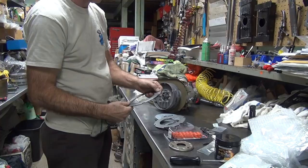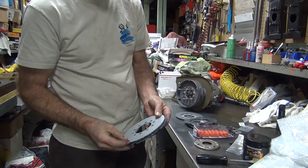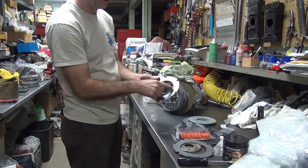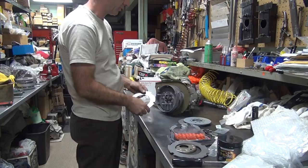It looks like it's in the plate material, too. It's in the wear band. That way it eats up the outer plate a little bit. That's good. It's only got two tabs on it instead of three like a big twin. So out goes out. You know why they do that? Because if you turn it around the other way, the load hits this button and breaks it right off. On the coast side, they still break and fall off because they're junk.